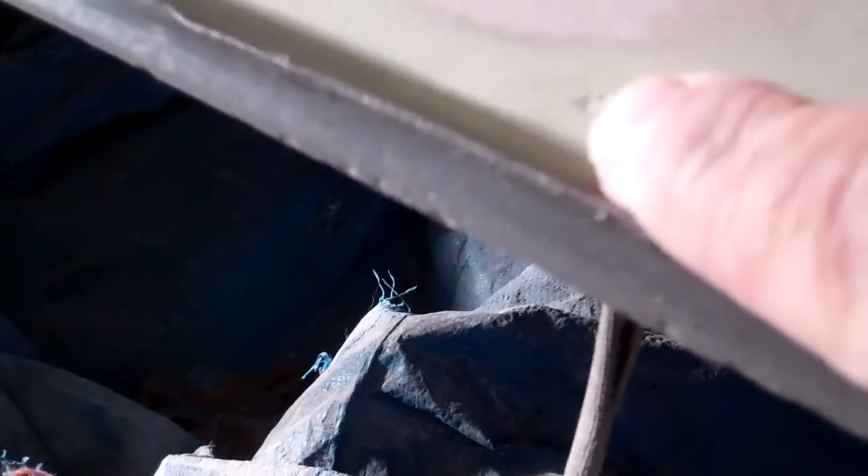What I'm going to do next is just put my final bits of body filler on here and I'm just looking for small imperfections like this little pinhole here. This is basically where the body filler probably dried up — too much hardener in it — and when I spread it, it didn't spread evenly. So I've just got to fill those in now with a light amount of body filler. I'm just going to go around and circle all of those imperfections so I can just fill them in.